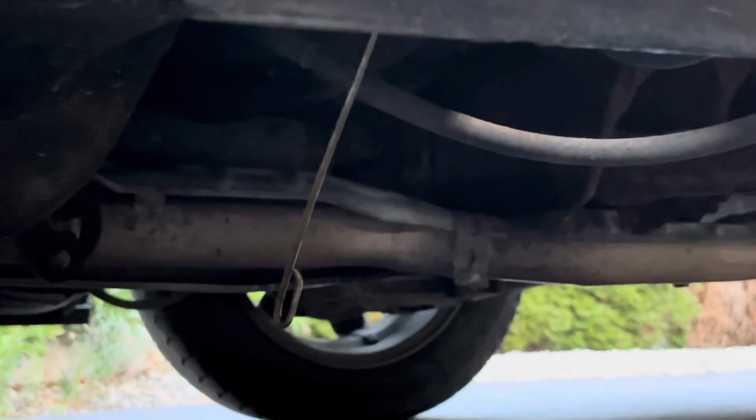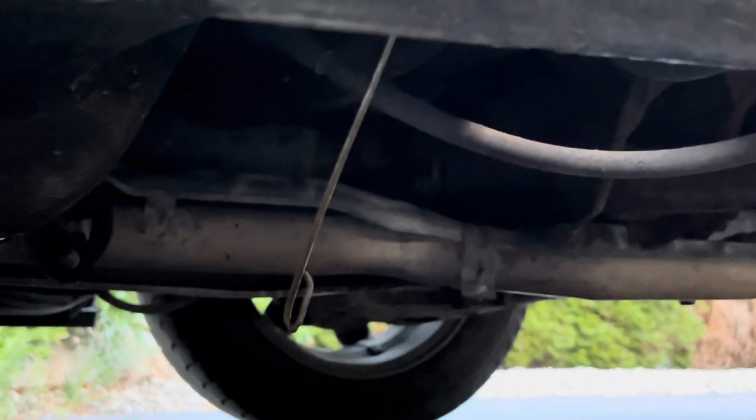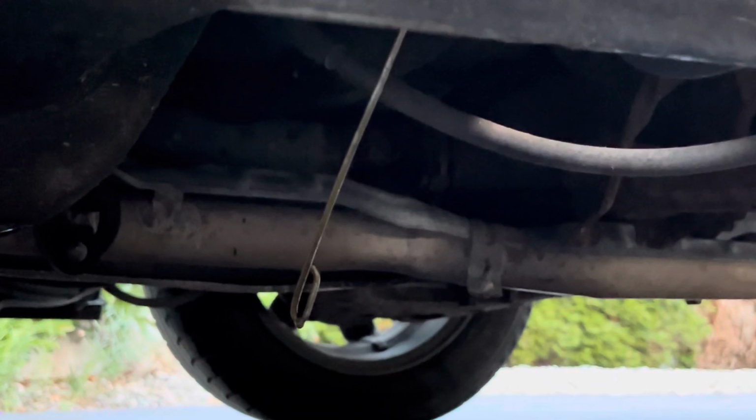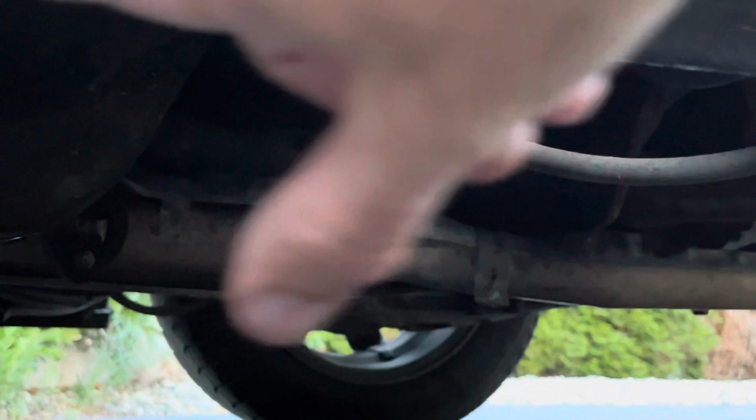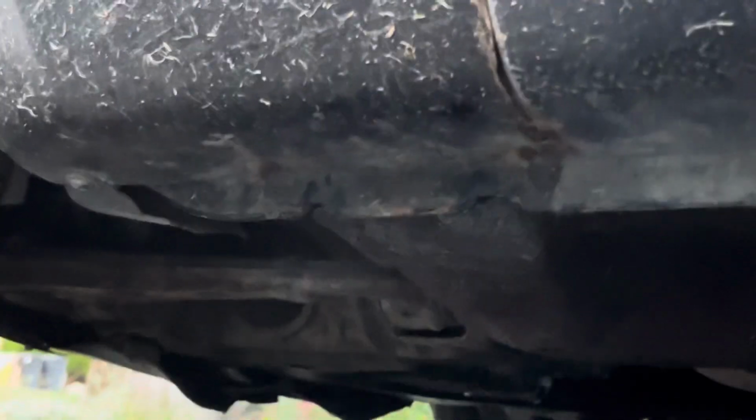and that will make sure that any water that goes through the rain rail into the cup actually goes through the tube and to the outside of the car. And it's the exact same procedure for the opposite side of the car. All the little drains are in the same place, which is right here and right here. For reference, so back up a bit, that's the door jamb, and that's where those are. They're just in front of the front fender on this side. You can see them still dripping there.